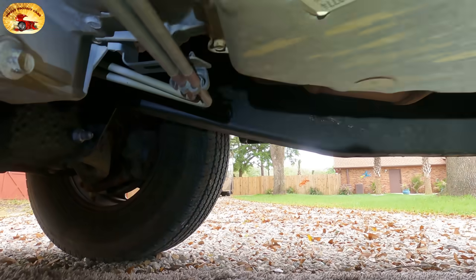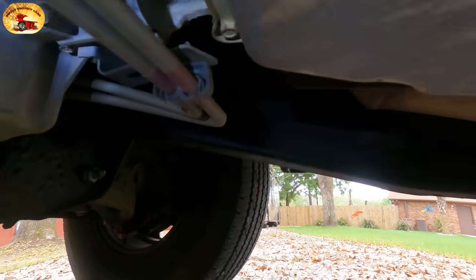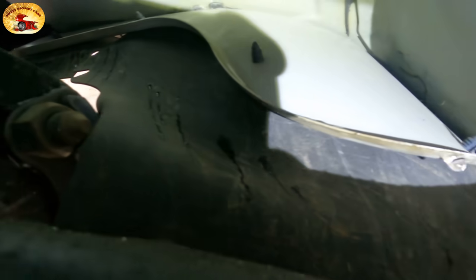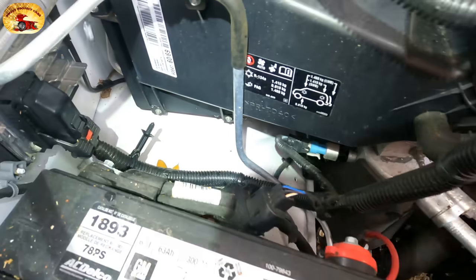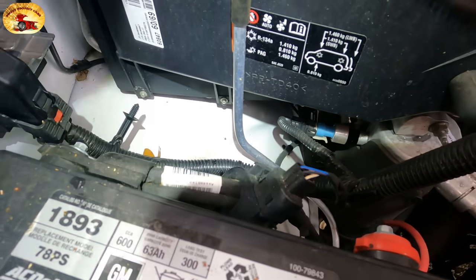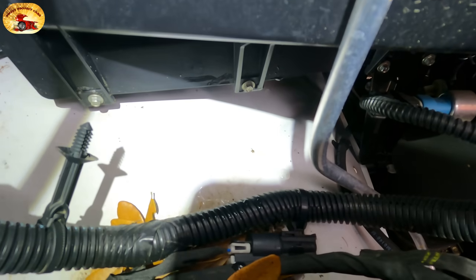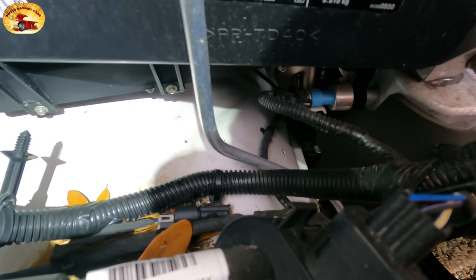This is how you find it — it's important that you find the drain tube. We'll go around to the other side of the vehicle. See that water running down right there? That means our drain tube is real close. Now this one does not have a drain tube, but you can add one. You can see that drip right there by that screw head.